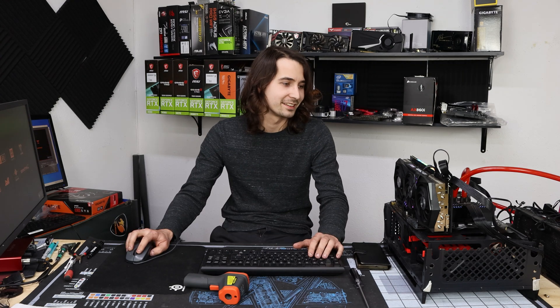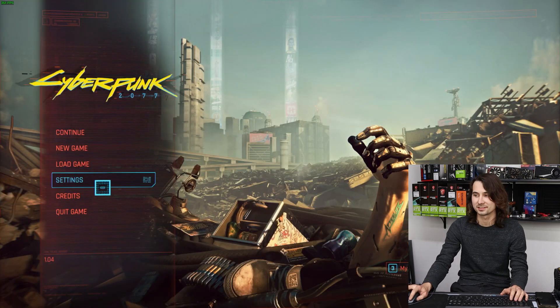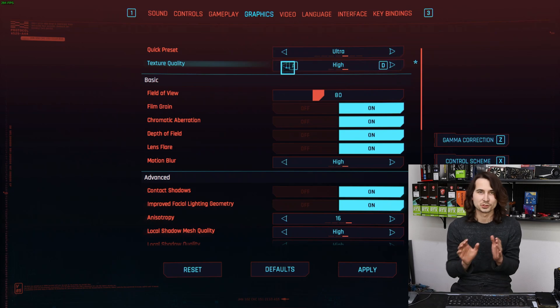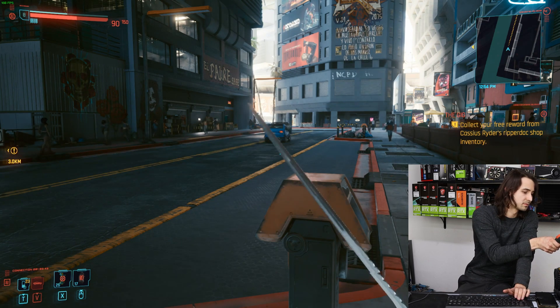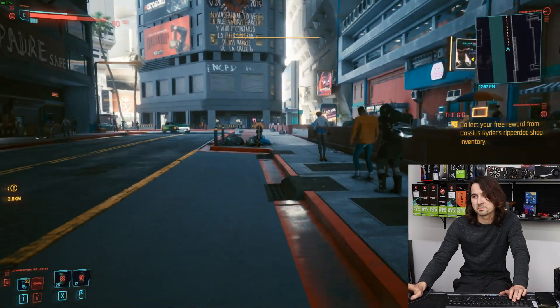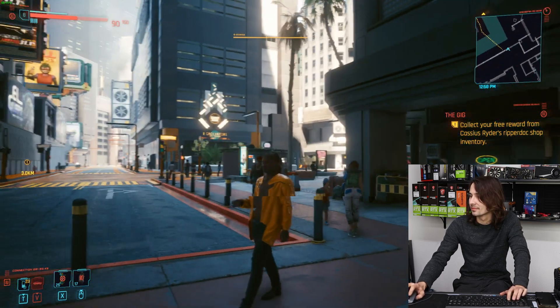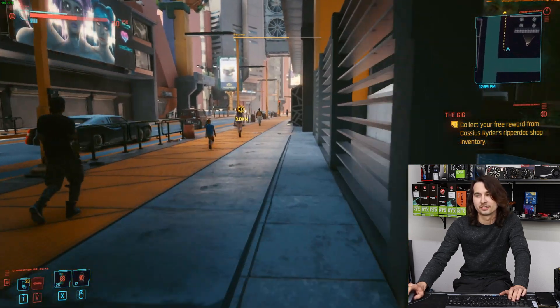Where's Cyberpunk? I want to see what happens when you're playing Cyberpunk and you start to hit a motherboard bottleneck. That 3080 has so much coil whine. This is a perfectly capable system for playing completely maxed-out settings. I'm actually going to skip ray tracing because I want to get as many frames as possible to make it more reliant on the CPU. The game's running at over 100 FPS. Temperatures are 70-ish C, highest I'm seeing is 78 degrees. Gaming isn't a high enough multicore load to cause VRM thermal throttling.